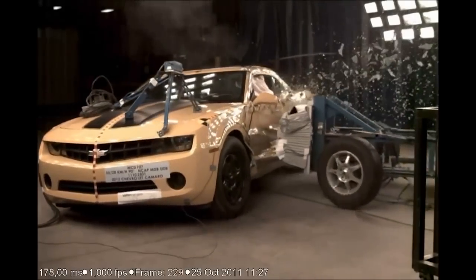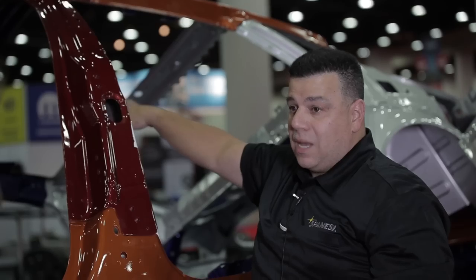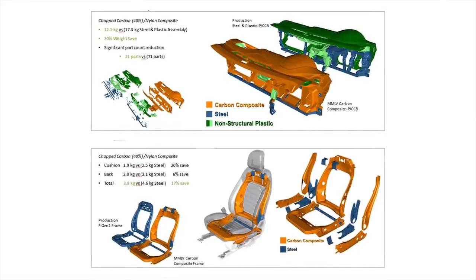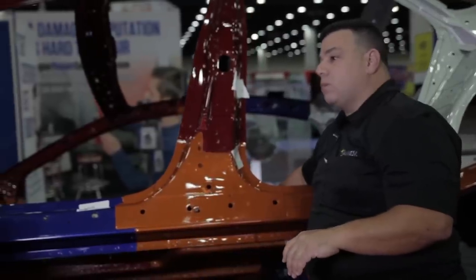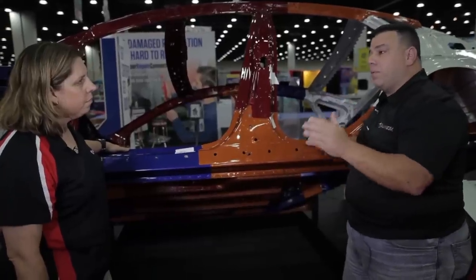The idea nowadays is not to let this area shorten the passenger compartment. Energy is meant to come in, dissipate here, go straight up the B-pillar, across the roof rails to the other side. The seat bars are usually made of boron alloy steel, with crossbars to transfer energy to the center tunnel — in this case a front-wheel-drive vehicle. The goal is to keep the occupants protected so you don't end up with a crushed passenger space.